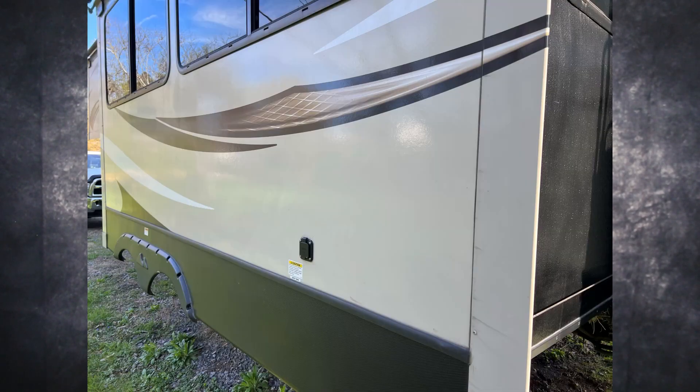I'm going to show you how we installed it here today. It was a little bit of a pain in the butt, but it ended up not being too hard. The first thing I had to do was remove the panel I was going to mount it to, as well as the outlet in that panel. I actually moved that outlet — which was from a power inlet that only powered my air conditioner and heat pump — to the slide. I put another inlet in because I didn't want to run the wire underneath the camper to the slide. After I got the panel out, I traced the outline from the Power Watchdog onto the panel, then used a jigsaw to cut it out.